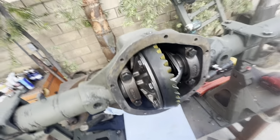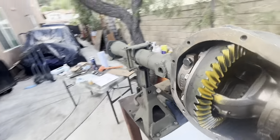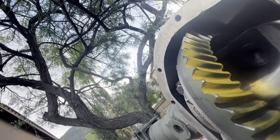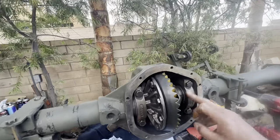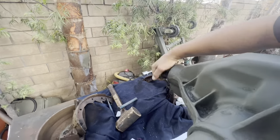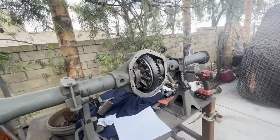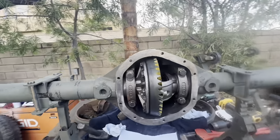Back out here the next day. Been messing with it a little more. I dialed in the top — looks pretty good. The bottom, the drive side — it's about the best I can get it. I'm at zero, I have no more shims on this side. Got no more rotational pull. Rotational torque is set at 18. Got seven thousandths backlash. I'm just going to run it.